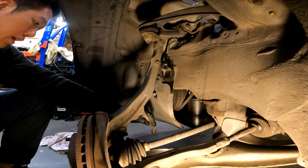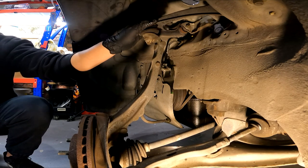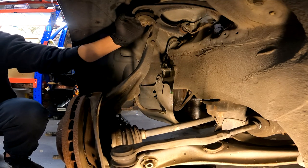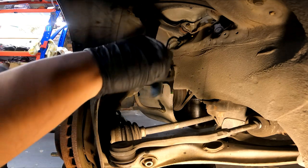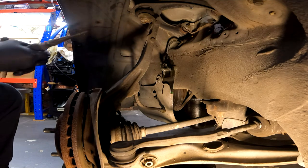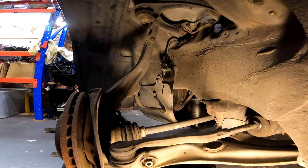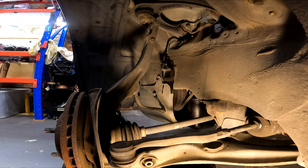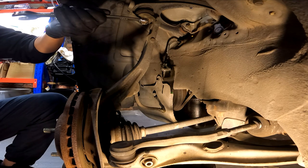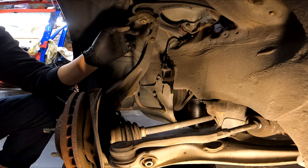Drain the rest of the caliper like that. Next, I'm going to remove the upper ball joint to the camber arm. I like to jack this up just so it takes the load off the ball joint, and then just where it's neutral, you're going to remove the split pin. That one is a 17mm. A little hammer if you need, or just with your hand like that.